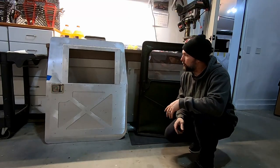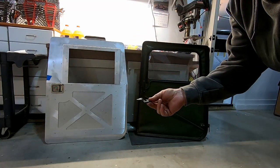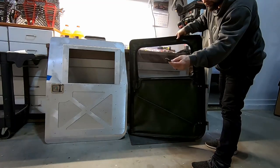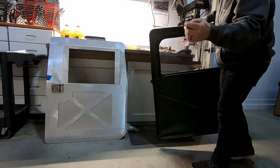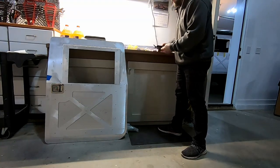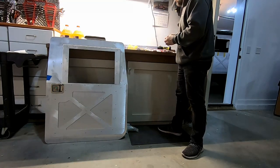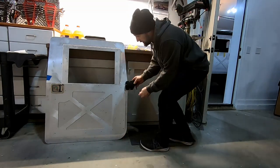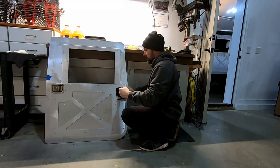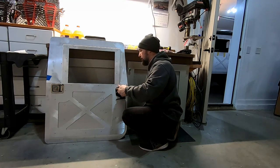A quick overview of your door swap process: first thing you're going to do is either purchase a door strap kit for your new doors so that they already have them permanently on it, or remove your door straps from your original doors. That's going to keep the door check — the door strap — from going too far. In the hardware kit they send with your new hinges, it's going to include one bolt longer than the rest. That bolt is for your door strap kit. You're going to want to put it on the middle of the upper three bolts to the door, so it lines directly up with the pillar in the truck.